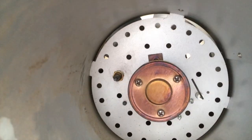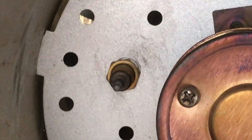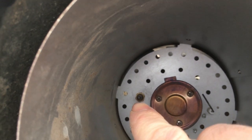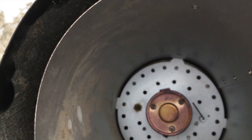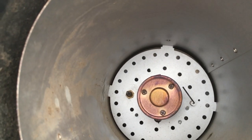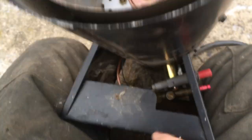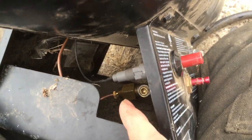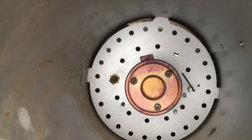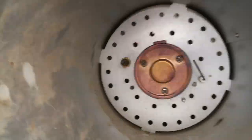Let me zoom up — this thermocoupler has a whole pile of threads. There's a nut here and a nut on the back. All I did was adjust it so that it was sticking up further into the flame. I turned the nut a few times, brought it up, and tightened it back again — and it worked right away. I didn't feel like spending $10 and waiting, so I thought maybe it's just not getting quite hot enough. Adjusted it, and it worked.